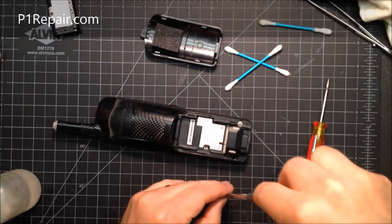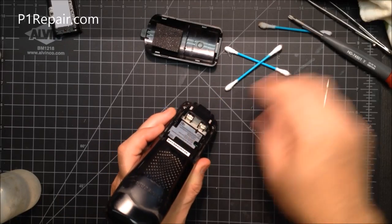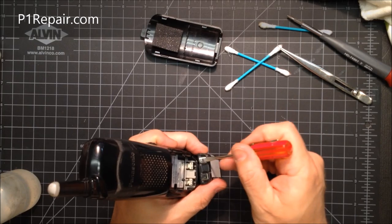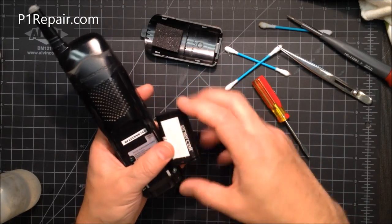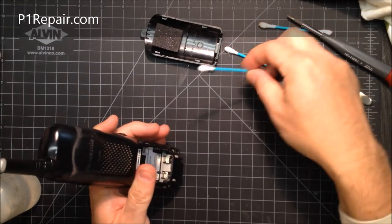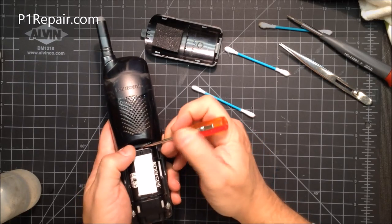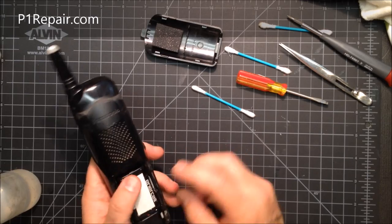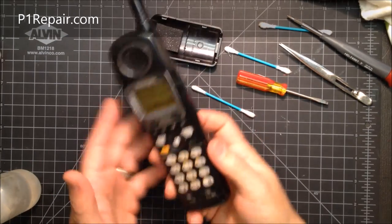These phones have notorious trouble with battery contacts, and there's not a lot you can do about it. The flat plate contacts aren't great — any invisible coating of dirt can mess them up, and batteries that are slightly thinner due to manufacturing differences can also cause a loose connection. A couple of tips: try cleaning the contacts with rubbing alcohol and a Q-tip, or wedge a small piece of cardboard behind the battery to put a little more pressure on it. I install spring contacts in all of these, which really cures the problem. Poor contact causes the phone to die fast, reset, or quit — especially when you shake or bump it slightly.